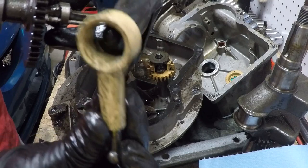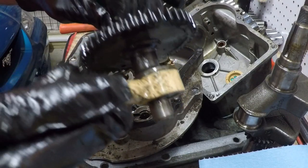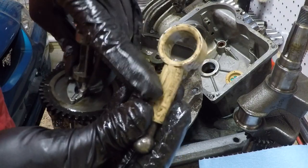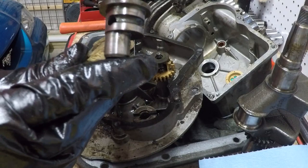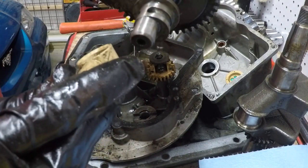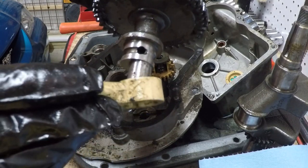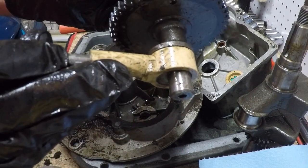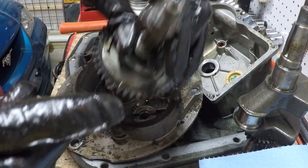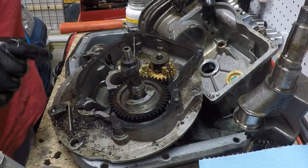As it pulls out, the area inside the pump fills with oil. Then as it comes around to the other side, it pushes out. Actually — I had that backwards. It pulls from this passageway and pushes into this passageway. This passageway is connected to the bottom of the crankshaft down in the sump, which is always sitting in a pool of oil. When it's pushing out, it's pushing oil up through the camshaft — so it pushes oil up through the top of the camshaft.